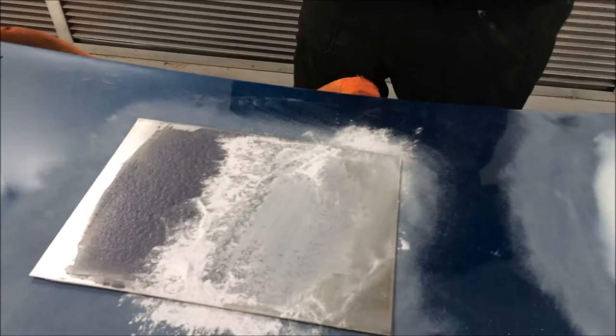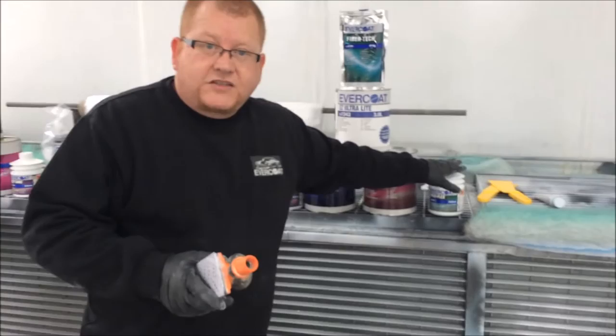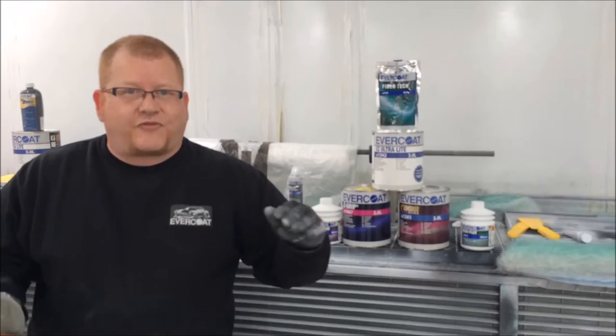You could use Rage Ultra. Probably for this product, for the application that you're going to be using it in, I would recommend something like Easy Sand. If you want extreme flexibility, it's Polyflex. Both are flow grade products, going to lay down very, very smooth and give you an almost sand-free finish where you are literally just going to tickle the surface.